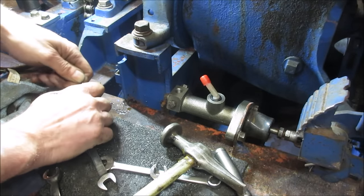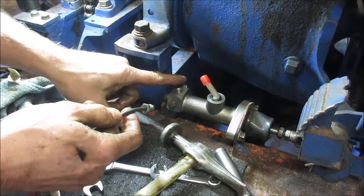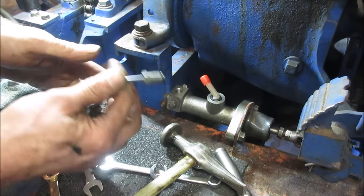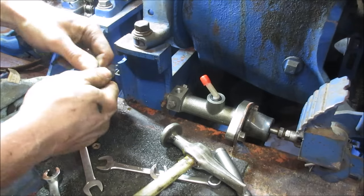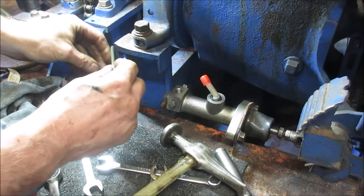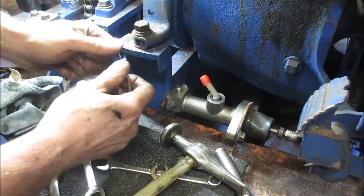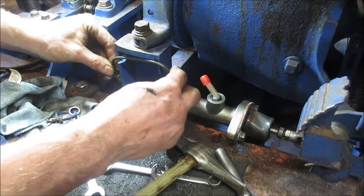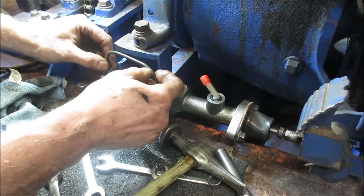And you could take an early car and just put a later master cylinder in it. Normally, I think the front was like right wheel, left wheel, and then this one just went out a single brake line to the rear. You just have to break that up and put it on the other holes. What that gives you, because the problem with this system is if you get one hole in a brake line somewhere, the whole system loses pressure. You have no brakes. Hence, that's why it was called an emergency brake instead of a handbrake, because in case of emergency, that's what you used. I think we're going to end up bending it out this way. We're going to be too long.